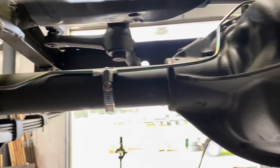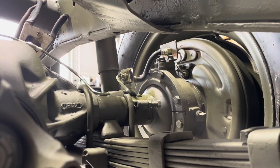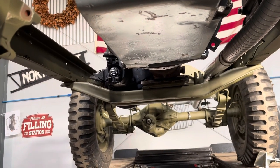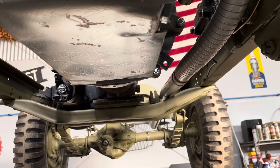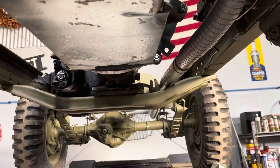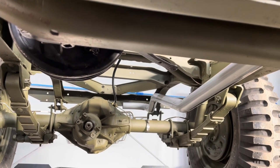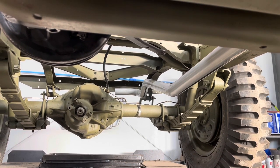It's the World War II style — put a little paint on there where I had to weld. Moving forward, I'm working out the exhaust system now. I'm not going to run it like the early World War II standard exhaust because that puts it in a bad spot where it can get crushed, so I'm going to run it out the back like the later war deep mud exhaust. I have a CJ2A kit that runs out in a similar path as the deep mud, so I'm going to use that and convert it to a deep mud exhaust type system. Just working out all the little details now.